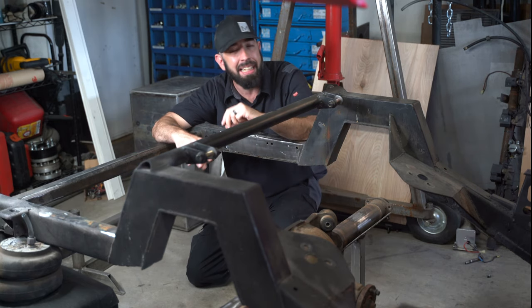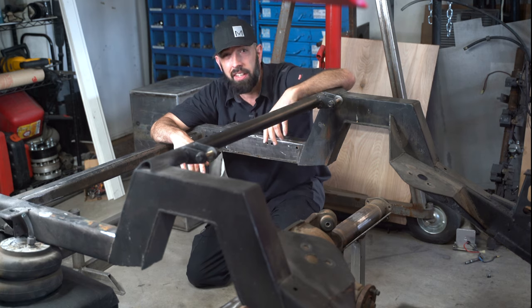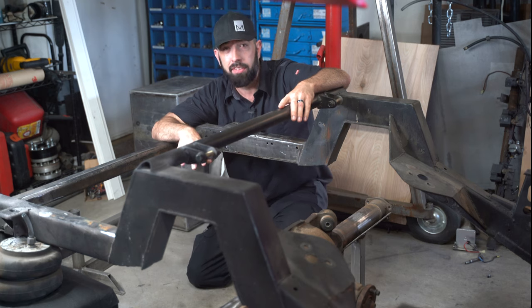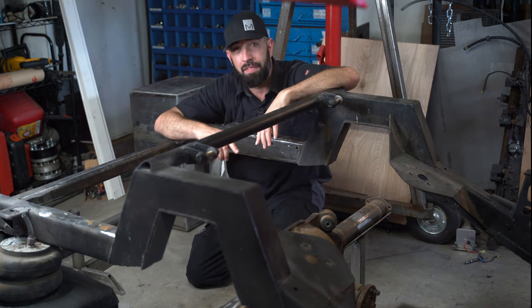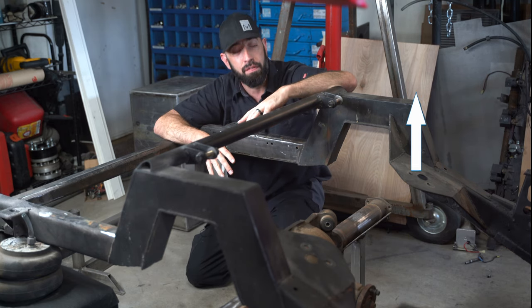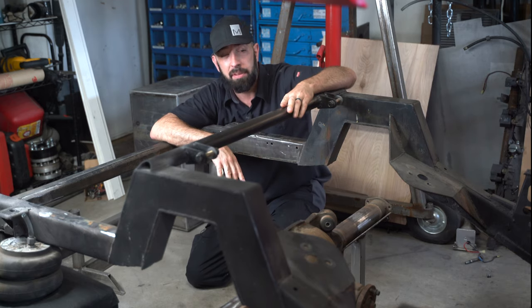When I bought this truck, I immediately welded in a bar across the notches. This is one of the most important cross members, especially on bag trucks. Bag brackets are generally welded to the side of the frame, and after a while the upward force of the spring will eventually cause the frame to twist — welding a bar across the tops of the notches will prevent that. So now there's only one cross member missing by the front bed mounts. I'm going to bridge the two mounts directly behind the cab, and since the previous builder proved those mounts are strong enough to support a triangulated four link, the cross member I'm adding is going to hold the upper bars of my parallel four link.